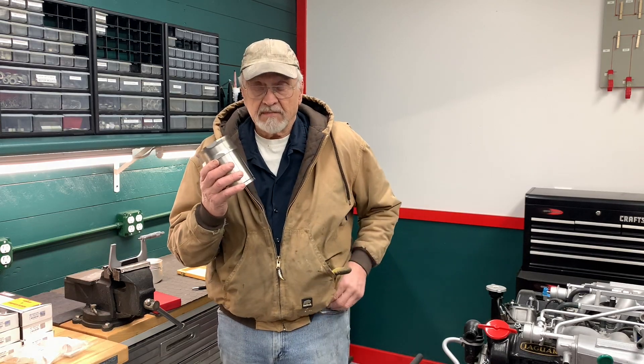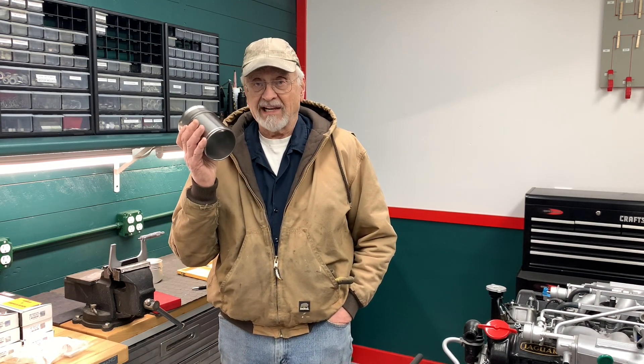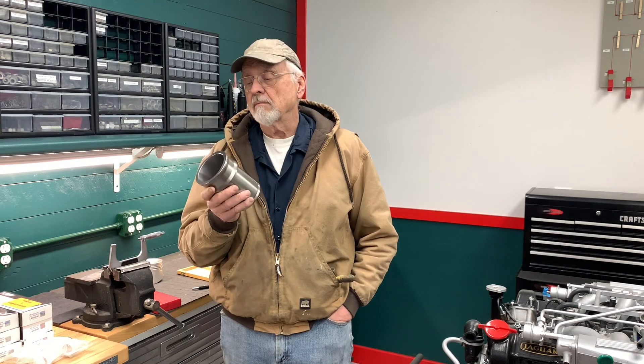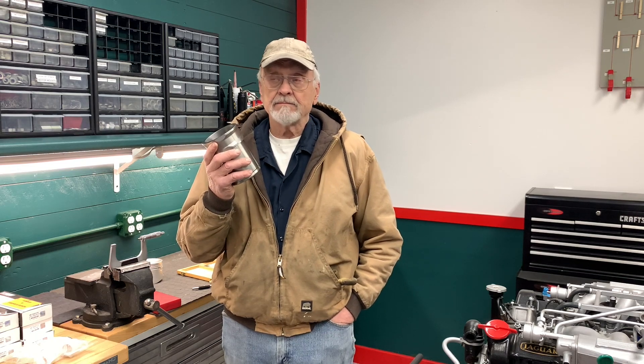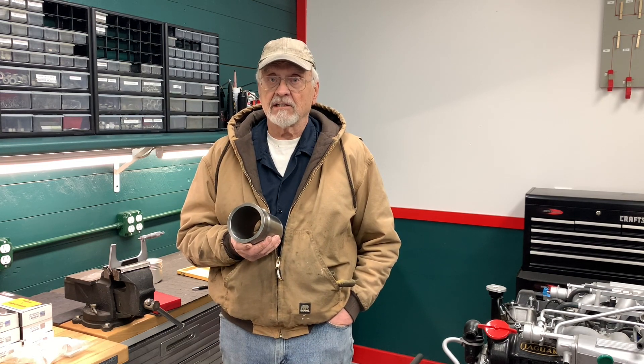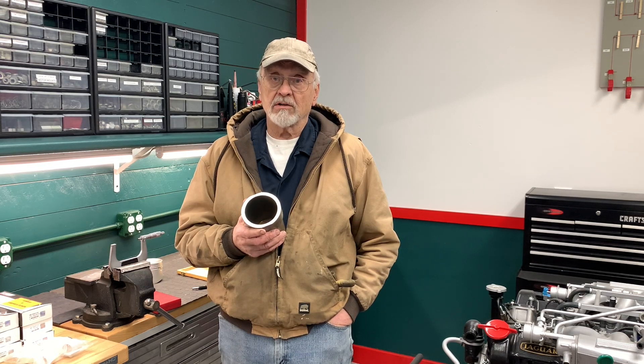Everything's here at room temperature. The solution, as I see it, is to look for another supplier of cylinder liners. I think Melling is a possibility. The other option, and this is the one I'm leaning toward, is that I've got a number of sets of really good liners that I keep in order to resize them as necessary. Based on Kenny's assessment of having worked on both, he says the stock liners seem to be a much better quality liner.